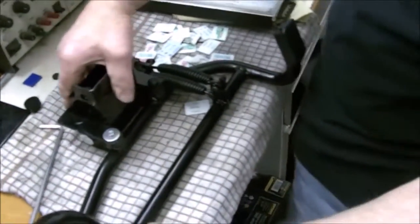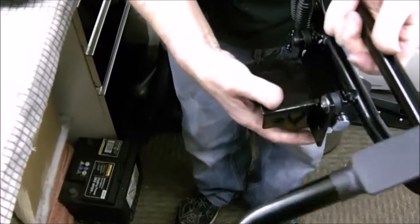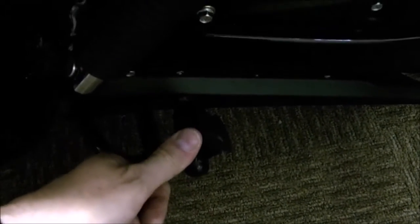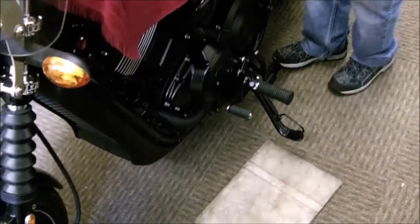Okay. And check the bounce. Does it bounce still and break free? No. It's just the way it was bolted into place. Okay, we'll just put the stand back on with the magnet in it. Can just about feel it pulling. Okay, whack it up onto its centre stand. Have a look, shortened stand with modified rubber mounting. Excellent.